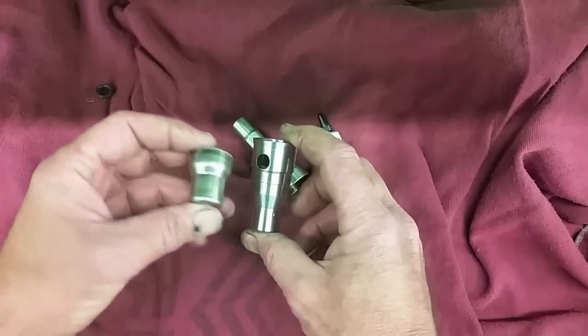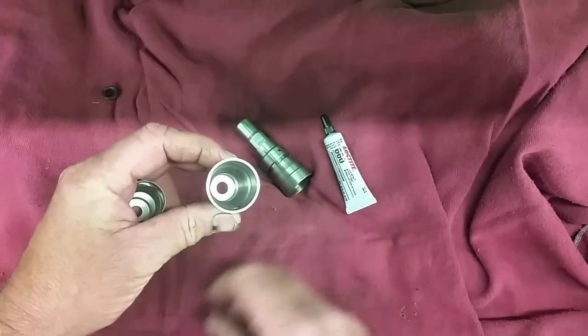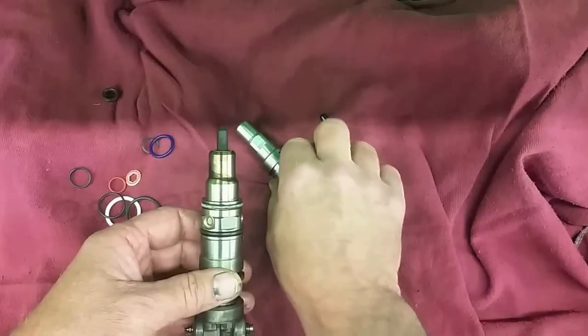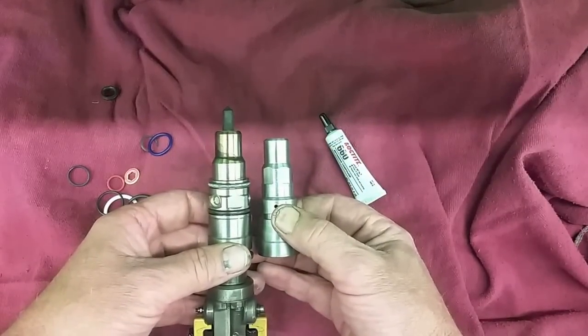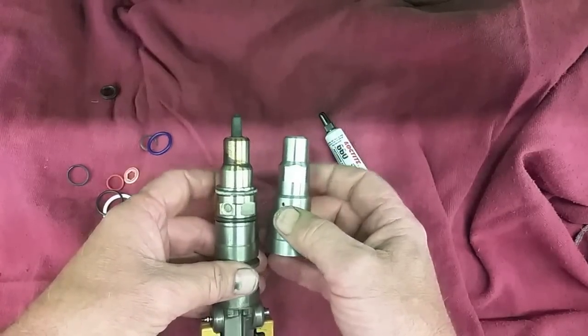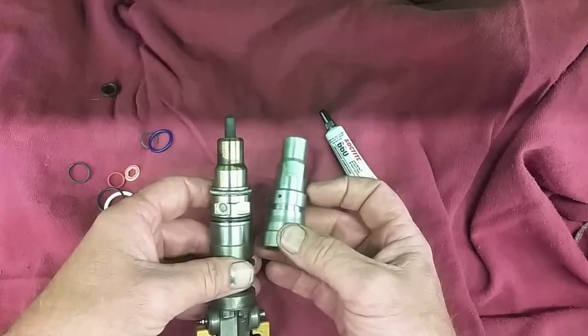You can see the difference right here. When you put this new liner in, your injector will no longer fit down inside the bore. So what they have here is this is the old injector — you're going to replace the tip at the end of your injector, which I'll show here. It's narrow; it's made to fit down inside the new sleeve. And this also only requires one seal just due to the design.